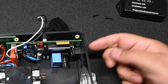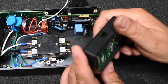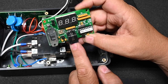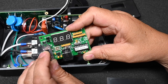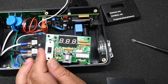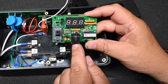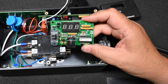The chip also drives this modular connector, which connects to the remote display box. If we remove the remote from the cover, we see another microcontroller — probably another PIC chip. It takes the serial data input and drives the display, and the other two wires handle the on/off switch. This allows us to bypass the EMS if it is acting faulty, if we're running a generator, or for some reason the EMS won't start. I scoped this with a data analyzer and could not determine the data protocol, so I'm assuming it's a proprietary protocol.